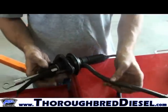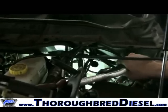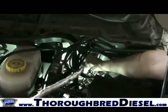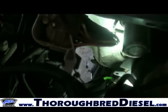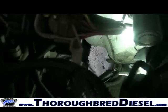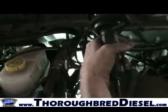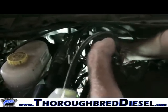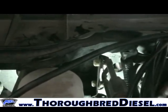We've got that started. Now we're going to go ahead and drop this in the truck and finish locking it into place once we get it inside the vehicle. We'll start by fishing our slave cylinder down towards the transmission. It will go between your brake box and your steering shaft, then to the outside of the frame rail. Be very careful of the starter because you've got no parts on here. Keep the bottom portion of your hydraulic line down. Before you go fishing too much here, you'll want to start your connecting rod and your electrical portion back into the cab while you're fishing your lines down through at the same time.